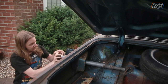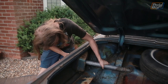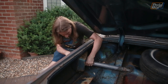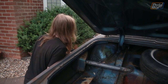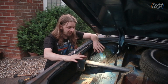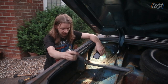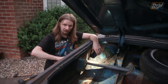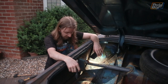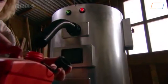This is the easiest filler neck I've ever seen to install — literally just a straight line. You do have to manhandle it a bit to get it into the port on the side of the car, but that finally is our filler neck back in. Which means the fuel system is now pretty much complete — we've got the lines looking fairly happy from our testing, the filler neck's in, the tank's in, everything's looking pretty happy. The neck was a bit more of a pain to get through the outer orifice than I expected, but we're all together and everything's tight.